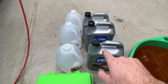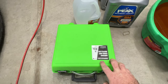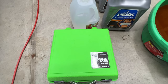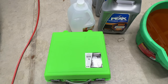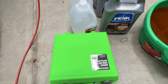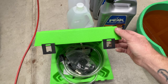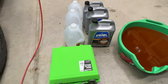I'll be using the OEM Tools vacuum coolant filler — I got it off Amazon a while back and I'll put a link in the description. I've used it on previous vehicles and it's awesome — it makes refilling a lot easier. What it does is pull a vacuum on the cooling system and then use that vacuum to fill it back up, so you get no air in the system. On newer vehicles, air in the cooling system can create cavitation, which you don't want. I'll mix the coolant in a five-gallon bucket for this tool.